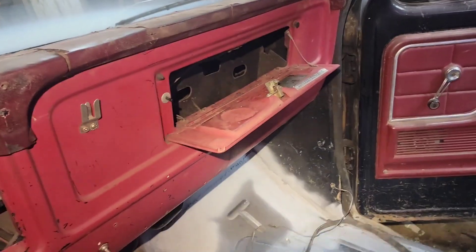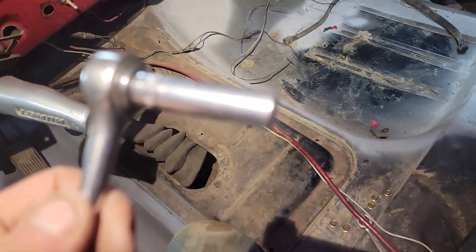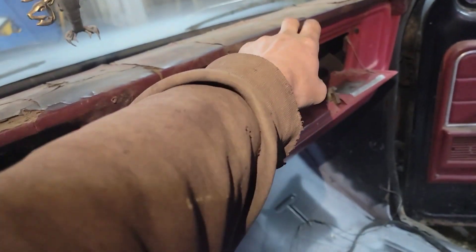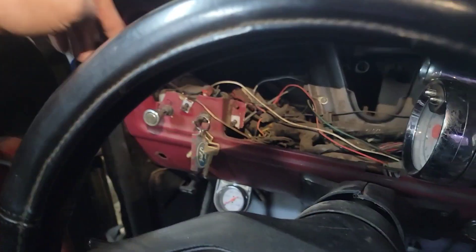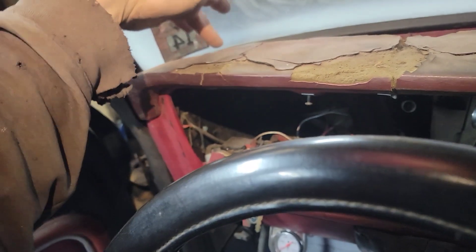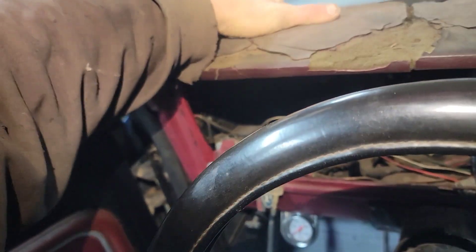You'll have three little golden nuts and it is a nine millimeter. You'll have three on that side, one halfway, one here, one directly behind it, then one that's on an angle over here, and one right here. This is how you remove the dash pad — bring up the back and pull it forward.